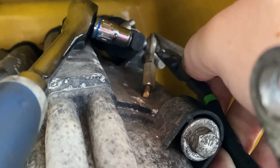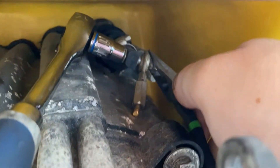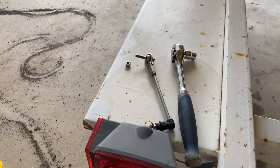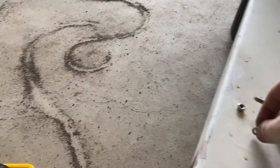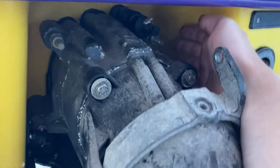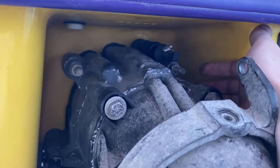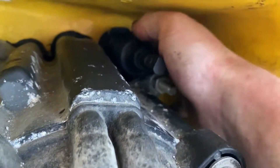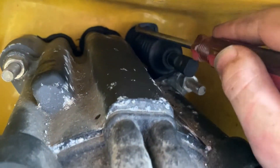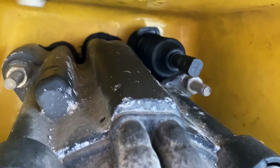It's a 10 millimeter on one side and also a 10 millimeter on the other side, but I don't have two wrenches, so I'm just holding it with pliers to get it off. I should be able to just slide it off with my fingers now. We're actually going to use one of the old washers for it. But before I connect the rod, I need to pull the old boot off and put the new one on so it seals it and no more water can get into the hole. I stuck a screwdriver inside the boot and moved it up around the lip until it was all the way on — that was the only way I could get it on.